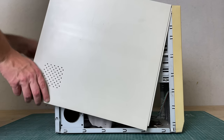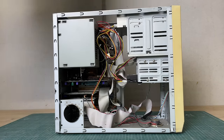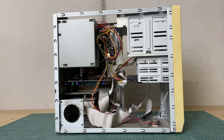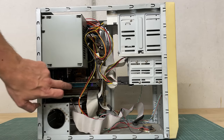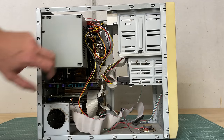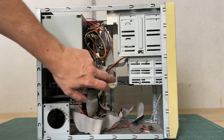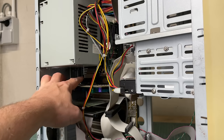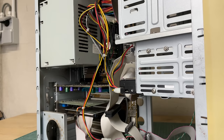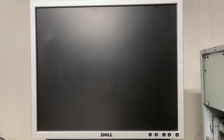To open up the machine it's pretty much like an AT style machine - there are no side panels that you usually see on ATX style machines. You can immediately see that this is a slot one architecture. Hidden beneath the power supply we have the CPU, a video card, some expansion cards, a CD-ROM drive, a hard drive, and if we move it to the side a little bit you can kind of see the slot one CPU sitting there behind the power supply.